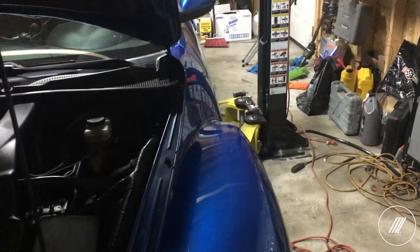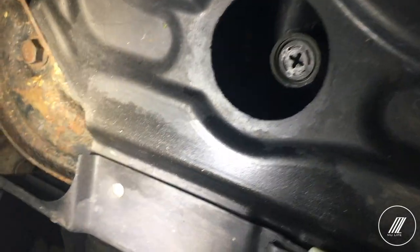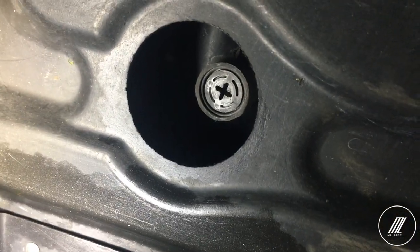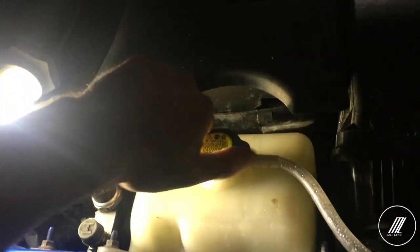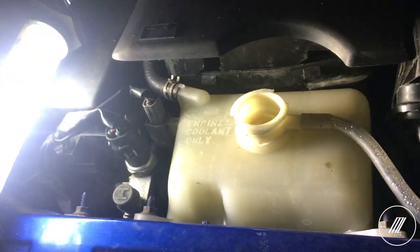Let's take this baby in the air. I love how this turned out — it's pretty clean. Let's get under the car and flush the coolant. It's pretty simple: just jack up the car and on the driver side you will find this access hole for the drain plug for the coolant. Just open that and it will flush the system. Make sure you open up the cap whenever you are draining something — that way if there's any air trapped, it just flows all the way down.